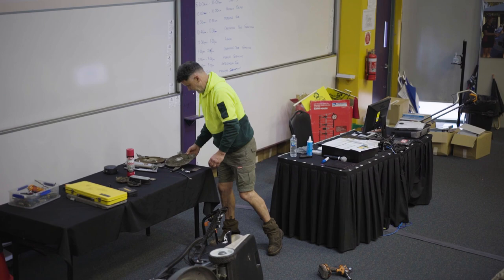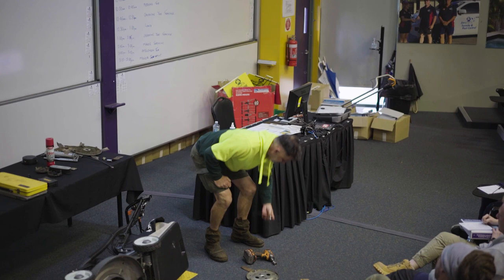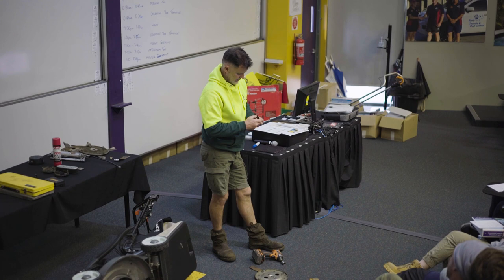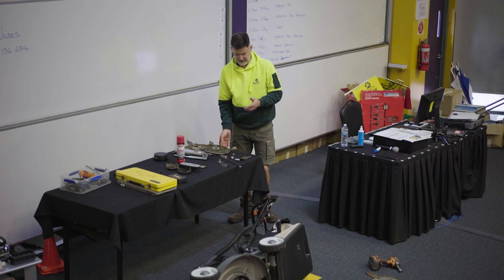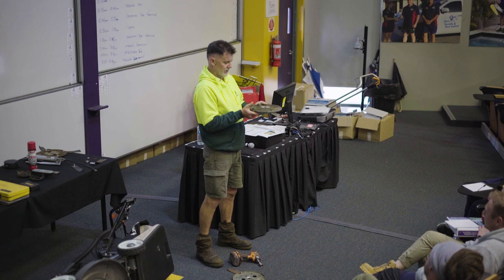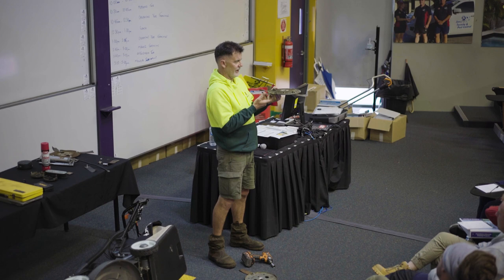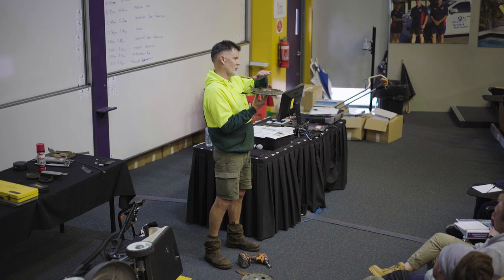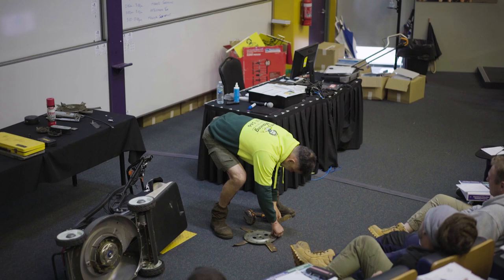Occasionally, also, there's this little washer. When you come to put the blade on, it goes bolt and then through that little washer. Occasionally what happens is when you run over a root, or come off the side of the gutter, or you've hit something a little bit higher, a rock, that little washer will snap. And then occasionally the blade will go under and get caught. If that happens, you can still get through the day, but every time you start, you might have to kick it out. Every time you go to engage the blades, it becomes a bit of a pain. So you try not to run over roots and things, because it damages that little washer, and that little washer is critical to stopping those things.